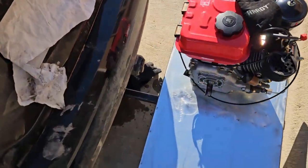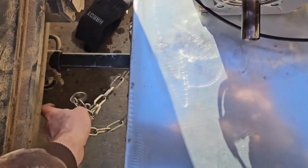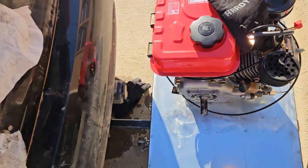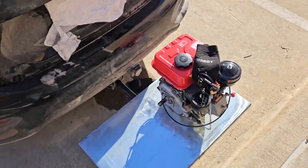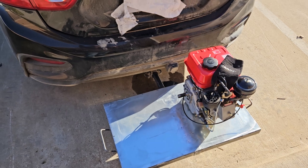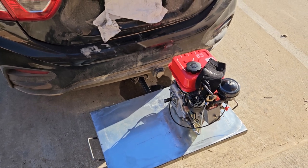There it is — a safety chain. I still need to untangle it and add the hooks; it's stainless chain. I welded it on so it would stop rattling, and that was a great idea because it tightens your hitch up big time. It's solid — like a part of the vehicle now. You don't feel any hitch slop at all when you're pulling a trailer, and eliminating that slop makes a huge difference.